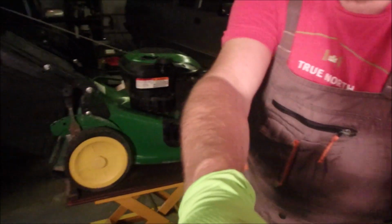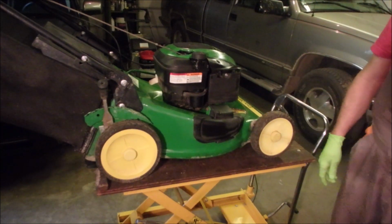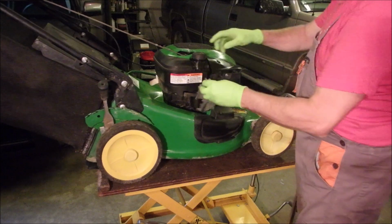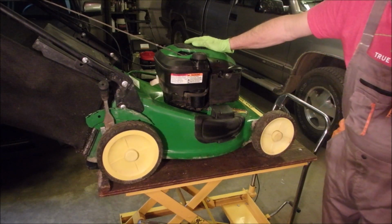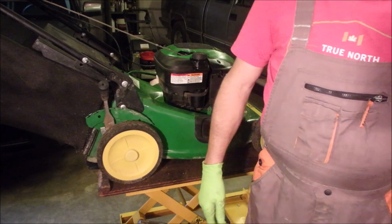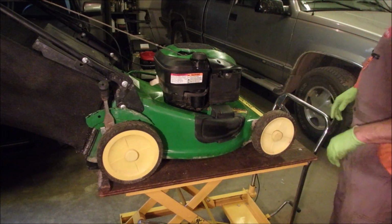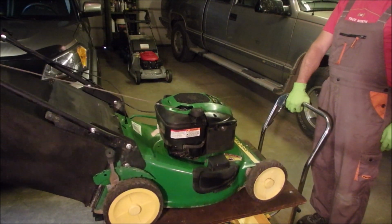Okay guys, you saw it first on Bruce Pender TV. Toro engine transplant to a John Deere, but that means nothing. It's a Briggs Quantum, but there were some differences. And I've only got about 3 threads holding that blade onto the crankshaft. But I'll go buy a longer 7/16 fine thread bolt later. I gotta see if this baby runs, right? It's automatic choke.